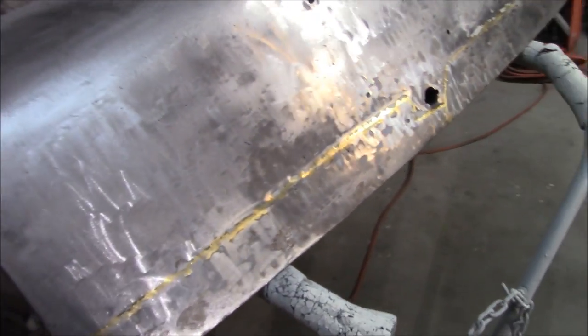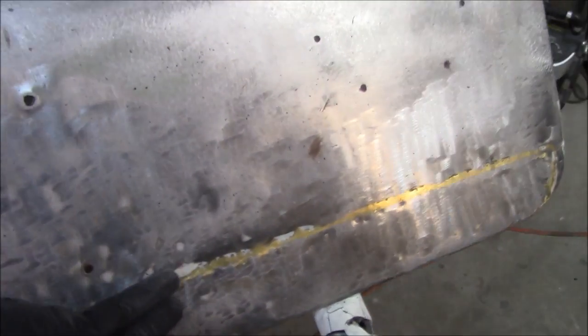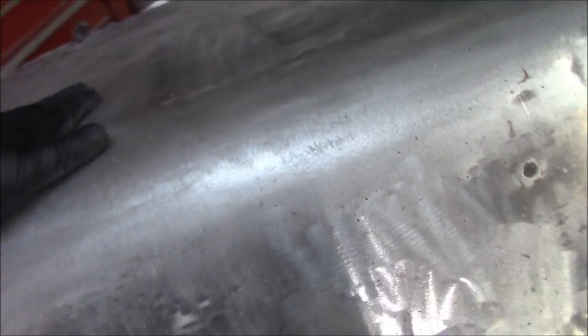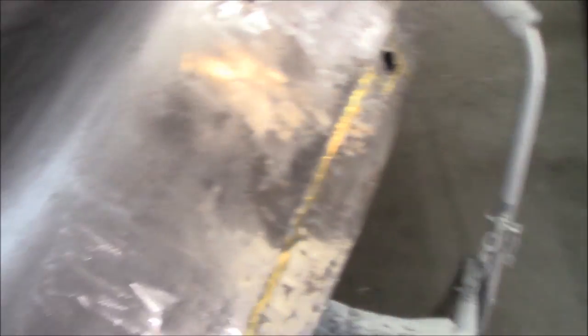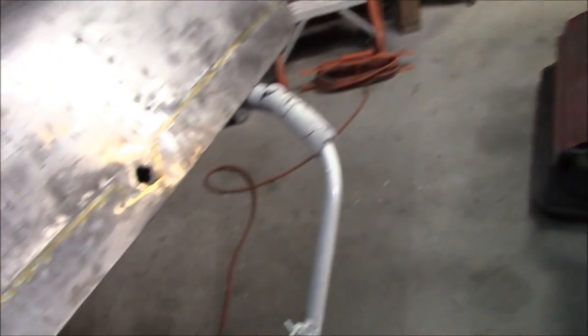Just a quick look at that nasty brazing at the bottom of the trunk lid. We're going to give it a quick rough-up with about 40 grit on a DA before we do a skim coat of fiberglass filler over this area to smooth things out. Then we'll probably do a scratch coat of regular Bondo over the entire trunk lid. This area looks pretty good - no visible dents up here, so it's actually not too bad of shape considering this car overall.